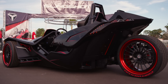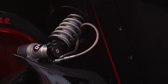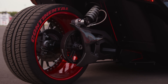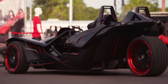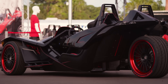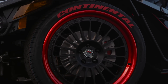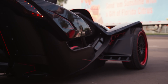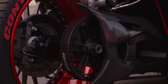From the rear, it's easy to see some really cool touches including the QA1 sport adjustable shocks. These shocks are adjustable from high speed to low speed compression as well as rebound. For wheels, we went with HRE 309 three-piece wheels — the interior of the wheels anodized red with the center powder coated black. They kicked in a set of 20-inch by 9 front wheels and a big 22 by 11 rear wheel for our project.